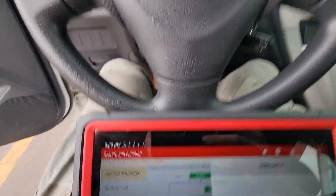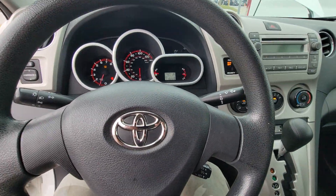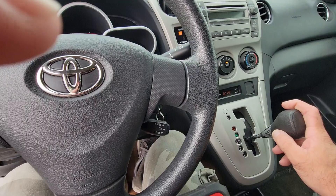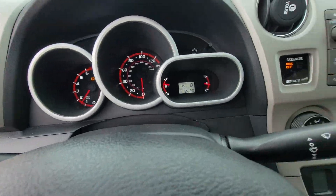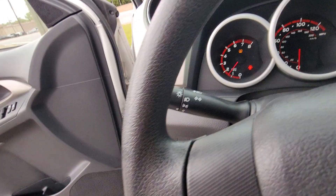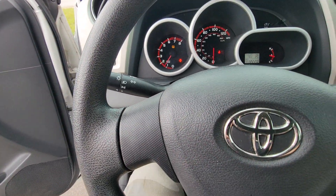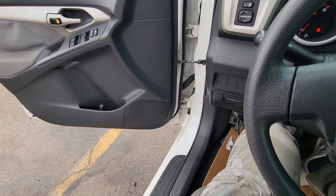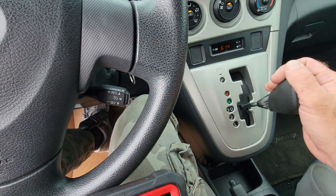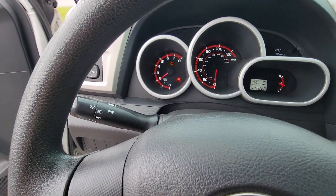I'm at this 2009 Toyota Matrix in the drive position. Doesn't pull, showing a B and D. Slipping. It's got reverse. No drive. No codes.